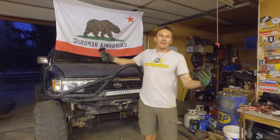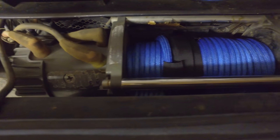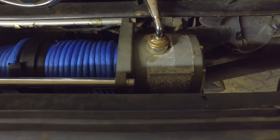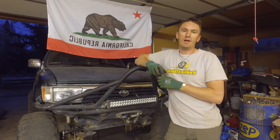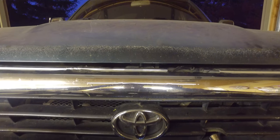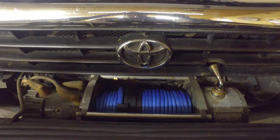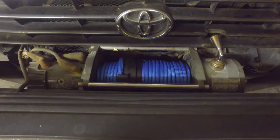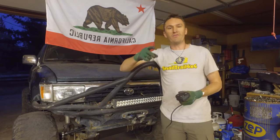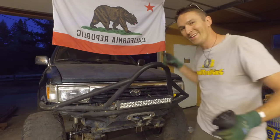That's how you do it. I hope you guys learned something today about winding up your winch lines. The main trick is to get tension on the line as you're winching it in and spooling it up on your drum. You can do that by having your car go up a slope or incline, or by lightly holding the brakes like we did. There are lots of different ways — anchoring to a tree, a light pole, or another vehicle. Make sure to hammer down on that subscribe button and, as always, keep crawling!